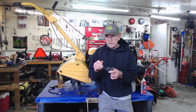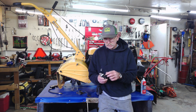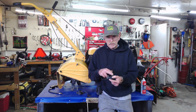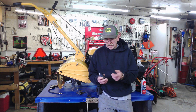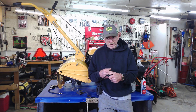If you mount it with the wire on top, your ground wire will be down at the bottom instead of on top where you can plug it in easier. It still has to be oriented correctly so it fires when it comes by the flywheel. What we usually do is put the ground wire on first, then mount the coil, and use a business card to bring it up tight against the magnets on the flywheel.